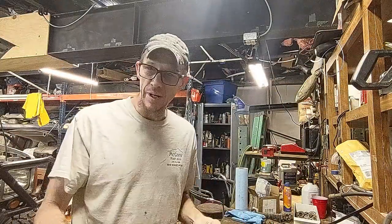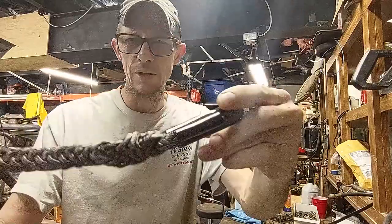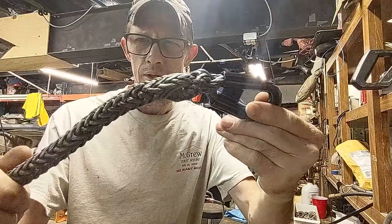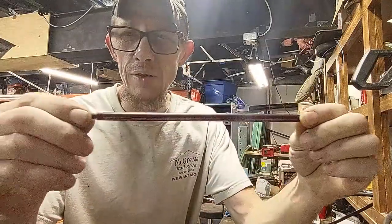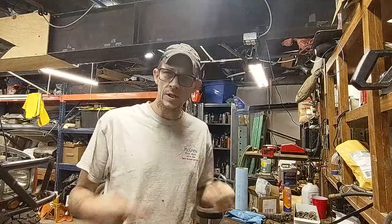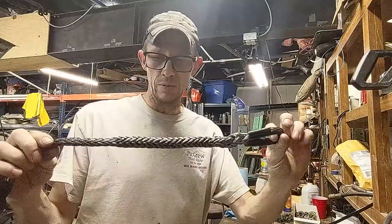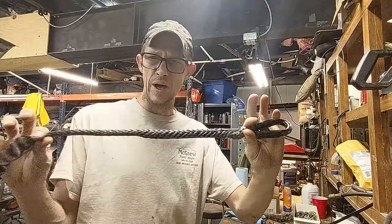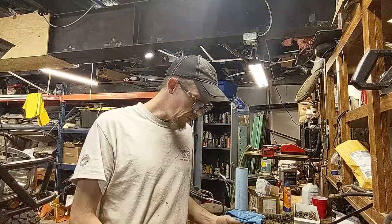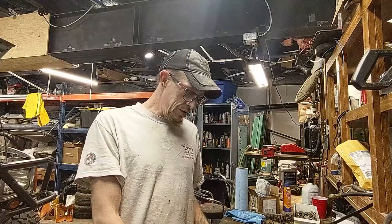I just kind of wanted to talk about the end splice on here. I'm not a rope professional. This is the bury that they put on this rope - it's got what they're calling the Brummel splice here. It's a little bit different than the regular bury splice. Factor 55 and their FID are recommending about a 30-inch bury for this 3/8 rope. This rope locks on itself like finger cuffs - the longer you have in there, the more stick you're going to get. The splice isn't a big deal, but I was going to cut this rope down because I don't need this much length in this back winch. So I'm going to cut this down and just re-splice the end so we don't have a bunch of rope bundling up. You saw how these tie rods were bent before - the winch rope won't do that, but we don't want bunching. So I scored a couple more ends and I'm going to re-splice this for you and show you what's up.